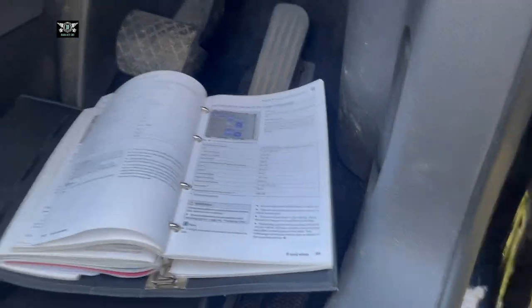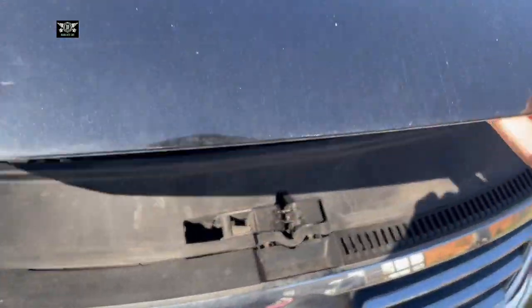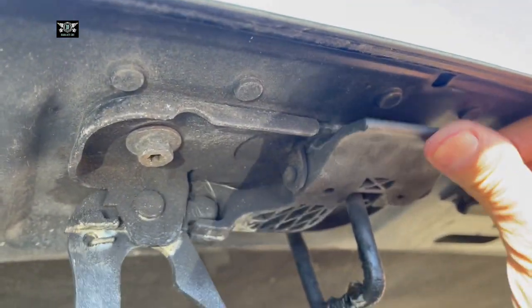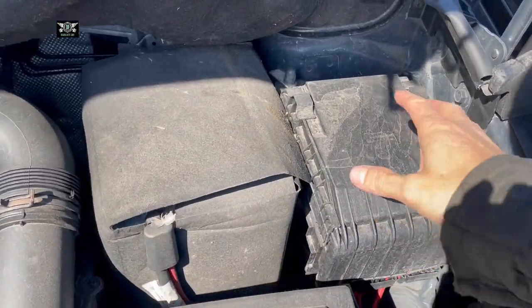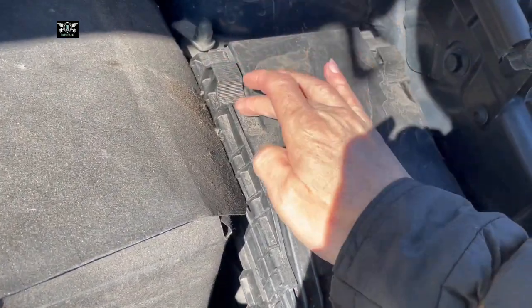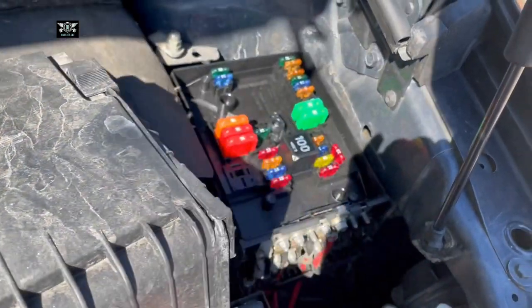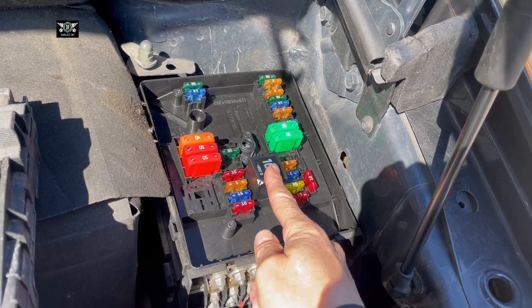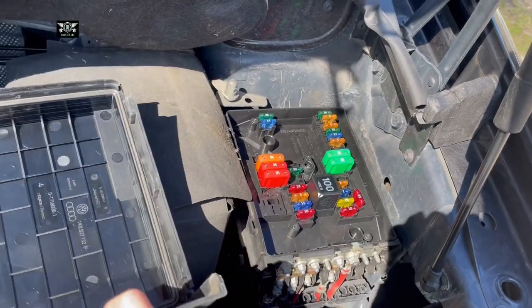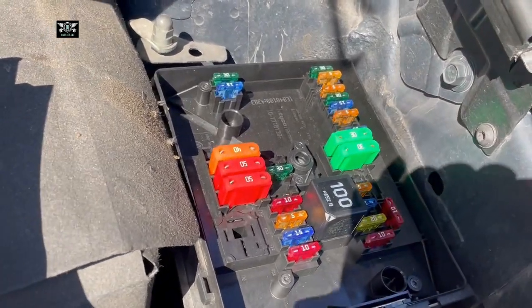Pull this over here to pop the bonnet. You need to press on that in order to lift the bonnet. Now on the right-hand side here there's a box — that's the box we want to open. You have to slide this forwards and then take that out, and there are the fuses. There's even a relay there, though the manual doesn't tell me what it's for.